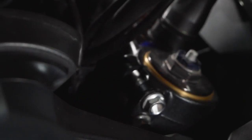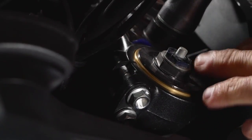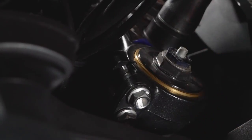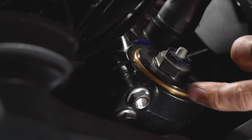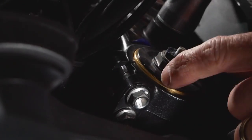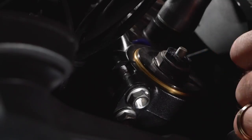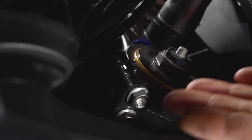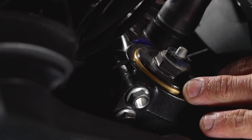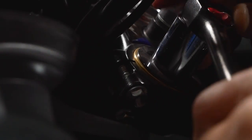I got that side loose. The reason I'm loosening the top part is so I'll be able to spin the top caps on the forks. It's good to remember what kind of spacing you had here — how your forks were mounted. If you're taking them out for the first time, check the exact spacing and even put a mark with a marker. Mine are sitting about one or two millimeters up. You can bring them higher to lower the front of the bike and make minor height adjustments. The top caps take a 24mm socket.